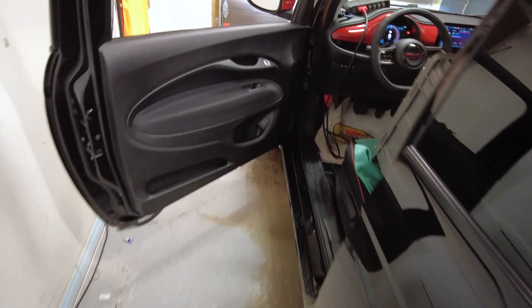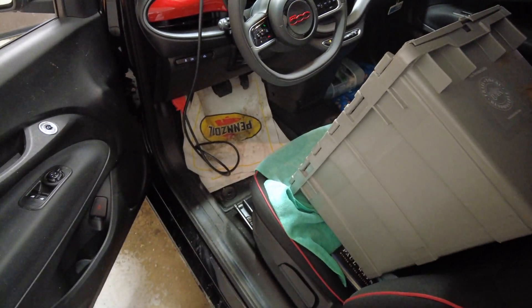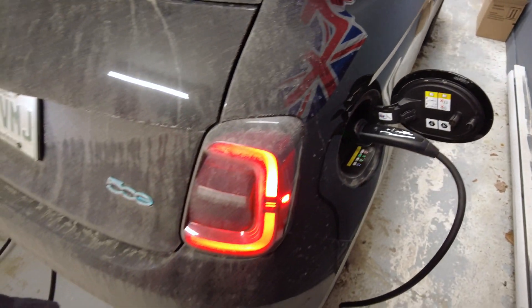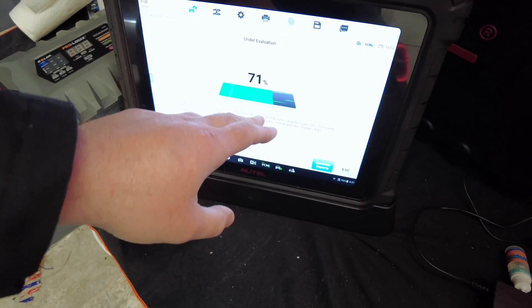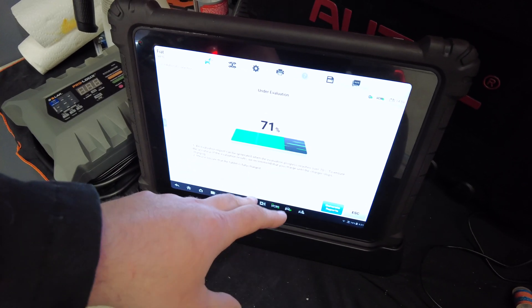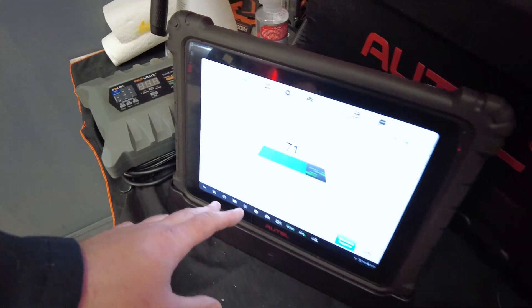Giving a little update after a few hours — we're at 75% indicated state of charge. I've had to set up a bin with some weights to make sure the car doesn't turn off; we're still in run. Everything is good, actually charging at 9.2 kilowatts. This is reading right from the BMS on the scan tool — it's reading 71% state of charge on the BMS. We could stop the test now and get an evaluation report, but I think we'll go up to about 90% or wait until it stops at 100%.